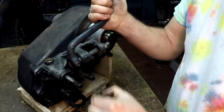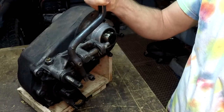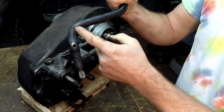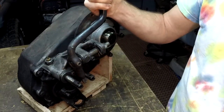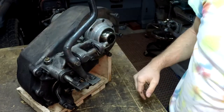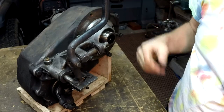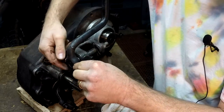Also the lever here is modified — I opened this up which allows it to pivot like this, so you want it to pivot back and forth. To get room in the opening on the transmission tunnel I had to cut it here and then bend it over so it would clear. That's really the only modifications I made. I think it works pretty good — it's probably not as intuitive as a twin stick, but you get the benefit of twin stick operation while keeping the stock lever in your Jeep if you want to keep it stock looking. Anyway, thank you for watching — I hope you like this video.